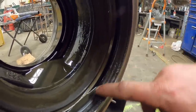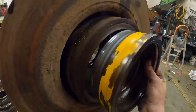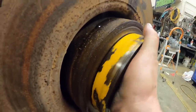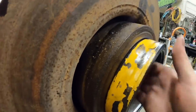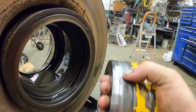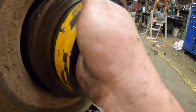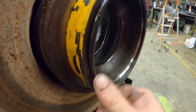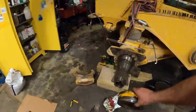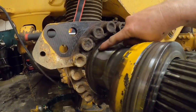If you guys can see, this here is the actual axle seal right there — we'll drive that out in just a minute. But this piece here actually fits up inside there — that's what the axle seal rides on. You can tell that thing is loose and it is worn out. What's neat about this thing is it's replaceable. So if that wears out — you can see it's got a pretty good little groove worn on it there — we can actually get a new one. It has an O-ring back here that is definitely shot. This thing then slides up on the axle and that presses up against this surface back here — and that's what seals everything off right there in the groove.